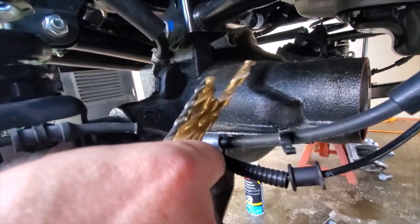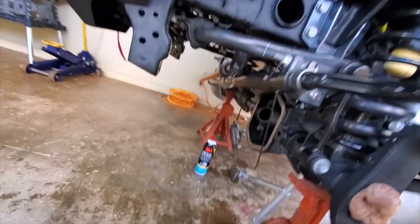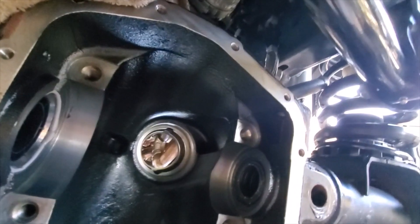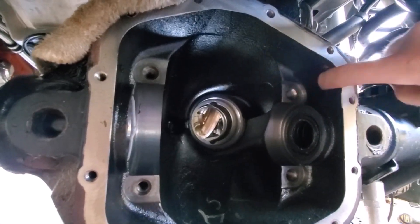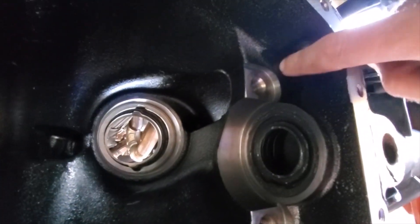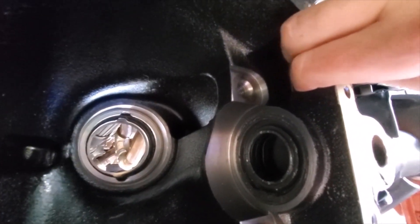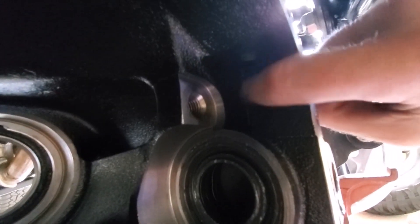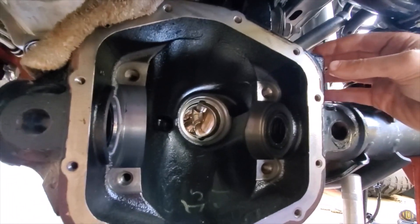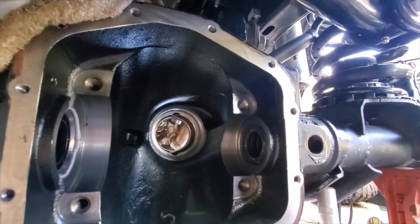We'll keep moving our way up in different sized bits. Our hole here will be in this nice little cavern behind the bearing cap on the right side. Your bearing caps go here, but you have this nice cavernous area. There's an area for a vent — that's where the vent tube comes out — and also a flat smooth area right here. You can see there's about a one-by-one inch cubic recess back here. A nice little area for Dana to allow us to add accessories, built right into the axle.